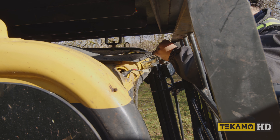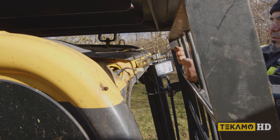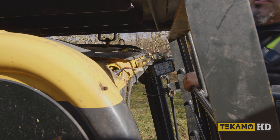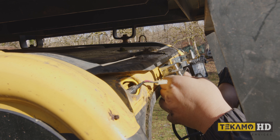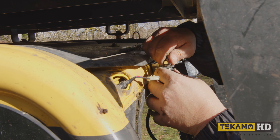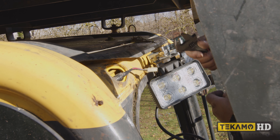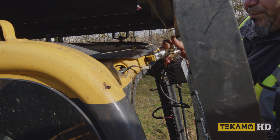We're going to have to twist it back a little bit, just let this kind of find its seat there. When coming up with a unique solution like building your own brackets, be prepared to make changes on the fly. Because of the bend, we discovered that the light would be better mounted upside down — this lets the light be adjusted freely without hitting the cage. Make sure you're test fitting along the way, because not checking what you're fabricating at different stages can cause wasted time and potentially unsalvageable mistakes in the future.